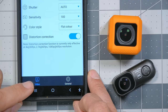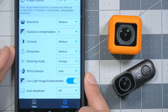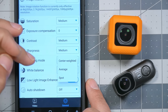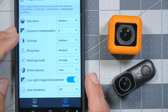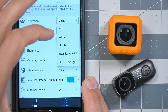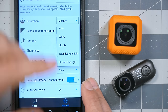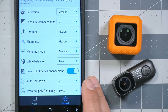At the bottom of the screen we can switch from video over to general settings, where we can see more camera options including the ability to adjust saturation, exposure compensation, contrast, sharpness, and metering mode. Definitely leave metering mode on average, at least for the type of flying we usually do. You can also lock the white balance — you don't have the option to select a Kelvin value, but you can set some presets. That's also a good idea if you're doing any color grading in post.